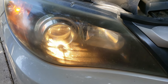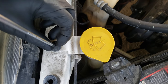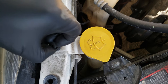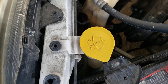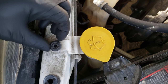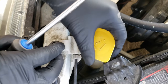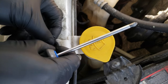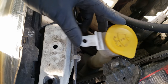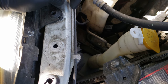On to the driver's side. This washer fluid piece will be in the way, so you'll want to get a Phillips head screwdriver to rotate the middle part of the clip so that it pops up a little, and with that you can pull the clip off. Now lift off the remainder of the clip. Just push back on the filler tube so that it gives you enough room to reach the headlight housing cover and the bulb.